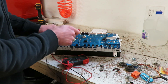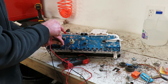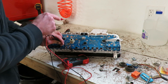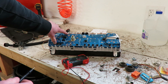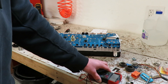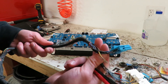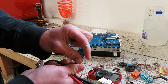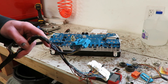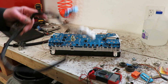Just stick one lead on there and run your other lead across these pins here. You can see this pin runs up over to here - make a note of where that is, second one over. Then go look at your harness and see what wire it is. It's most likely empty, so that's why we got these pins. We'll stick that pin in that place of the connector in the truck and then solder the other side to the glow plug light wire coming from the Volkswagen ECU.